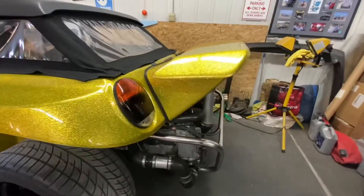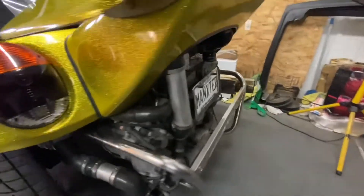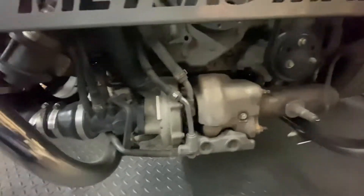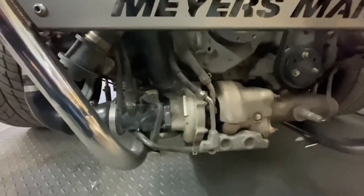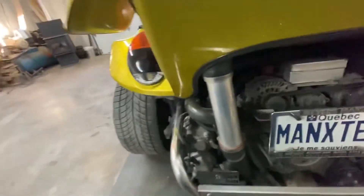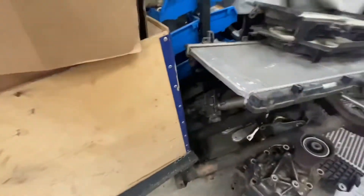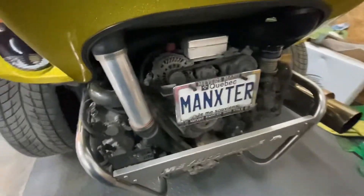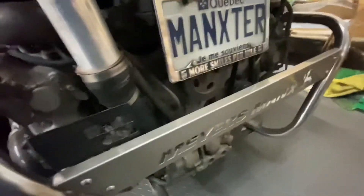Somebody made a comment about what I was using for an intake. Because it's a turbo — the FA-20 turbo is right there at the bottom of the manifolds — it's a very short throw. They call it a twin scroll, so there are two inlets. It spools up really quickly, I'd say under 3,000 RPM, pretty much fully spooled to what it needs.